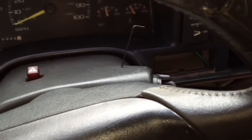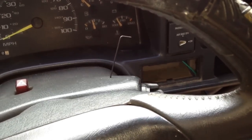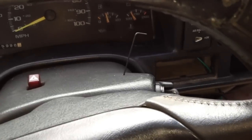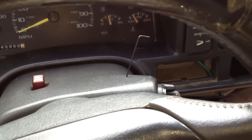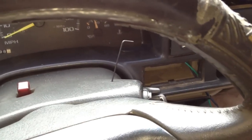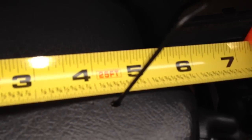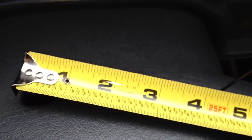I'm here with the 1997 Chevy K1500 pickup truck. I'm just showing you how to replace the ignition lock cylinder the easy way without having to take the entire dash apart. The easy way to do this is you have to drill a hole through the top cover of your steering column. It's a very small hole, very hard to notice. You can even buy a new cover if you really didn't want to drill it. Four and a half inches over — I'm hooking the tape right on the hazard light — four and a half inches over, and you drill a hole straight down in. It allows you to access the lock cylinder retaining pin.